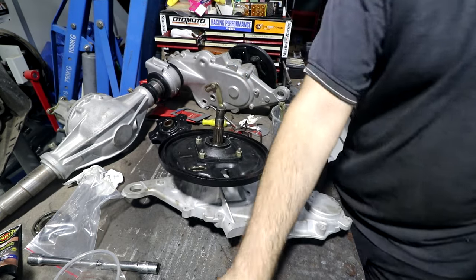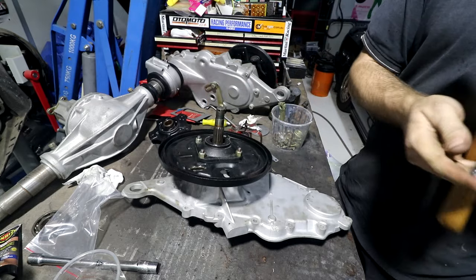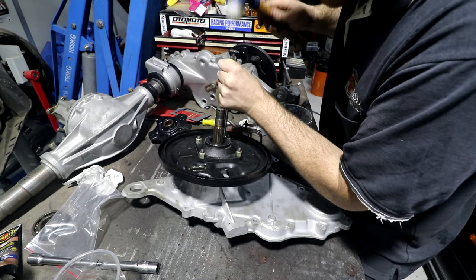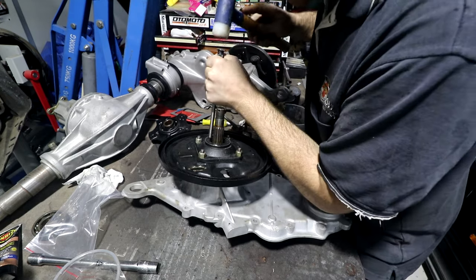This is also another example where someone will tell you you should have a nice thing to fit over this and hammer it all in one go. But if you're not a Neanderthal and you're just careful, no reason why you can't work it in evenly with a punch. A nice big flat punch, but a punch.